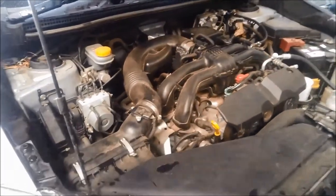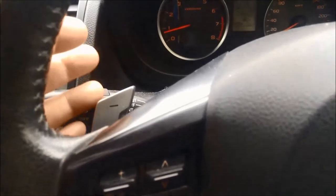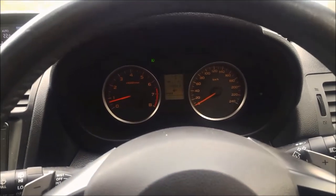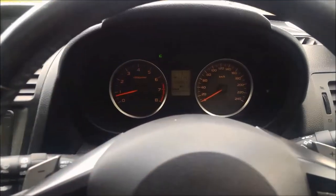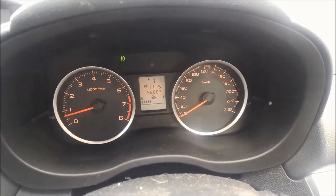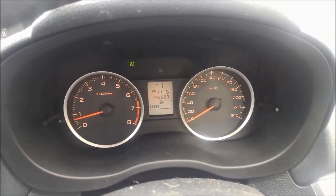Now I'm going to take it out for a test run and we'll see what's happening. Basically what I've done is gone through selecting the sports shift on the paddle shifters and just gone through the shifts manually — up down through the shift pattern and back down as much as I could. The idea is to try and flush the solenoids if possible. Her codes haven't come back for a while, so we'll do a service on it.